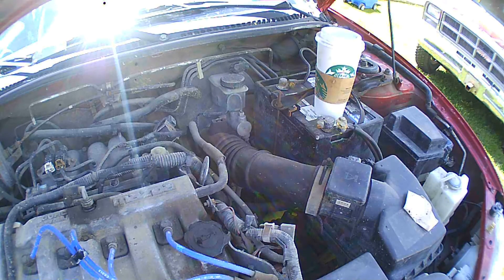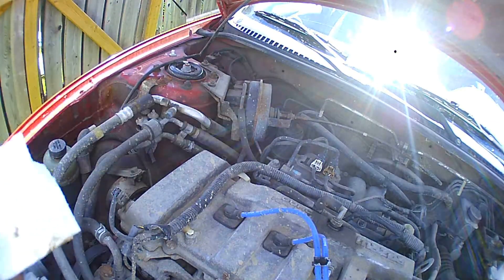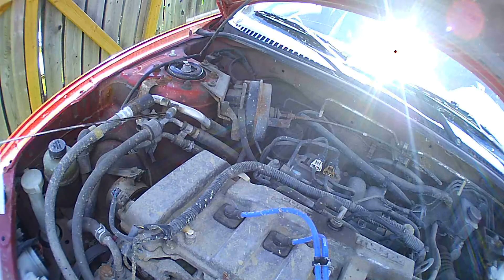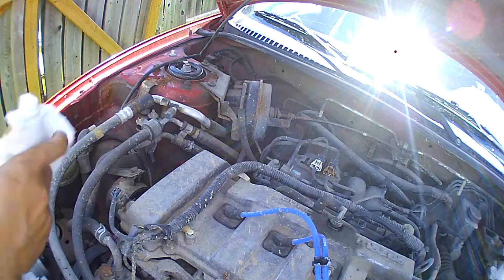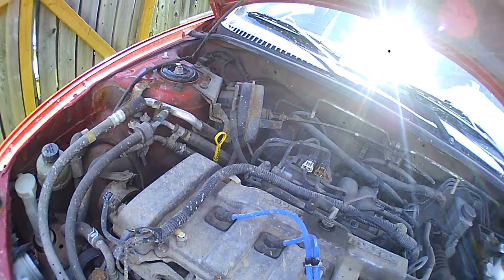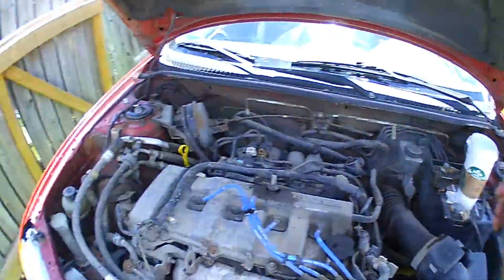Now with your paper towel, you want to check your dipstick. I know the vehicle is up on a ramp right now, so it's going to read a little incorrect, but it gives me a rough idea of where I'm sitting. It says I'm a little above full. Like I said, I'm on a ramp right now and we haven't run the car to fill the oil filter yet. So I'm going to have to take this car off the ramp and run the engine.